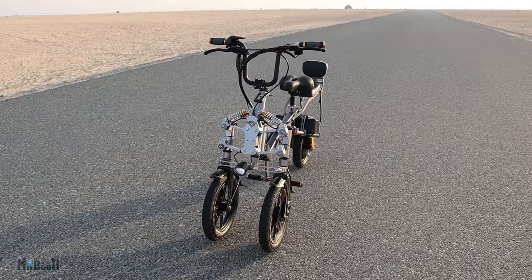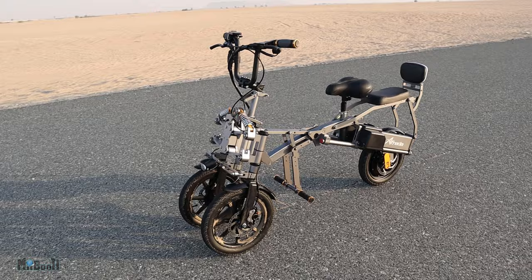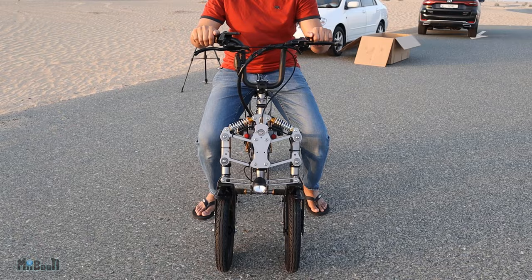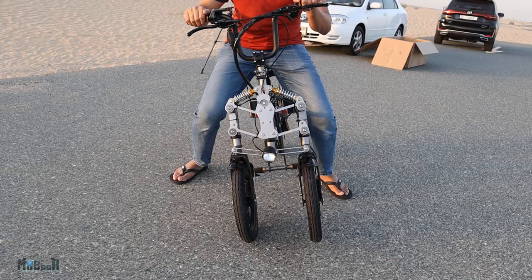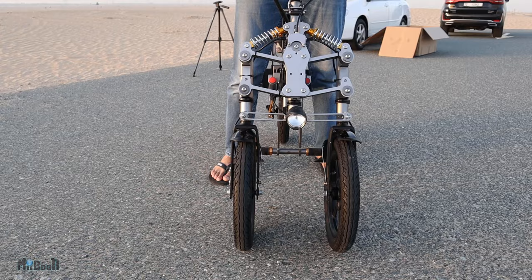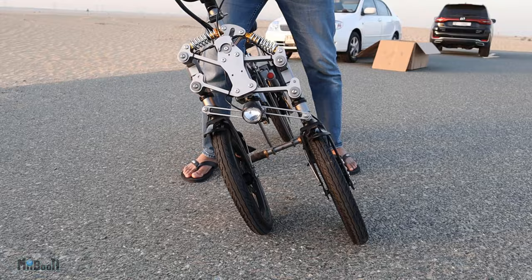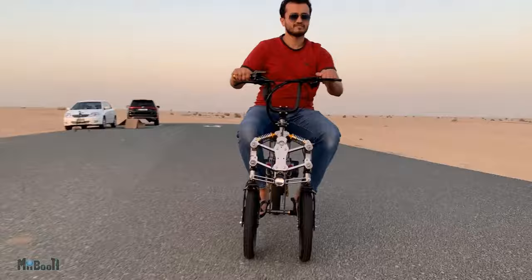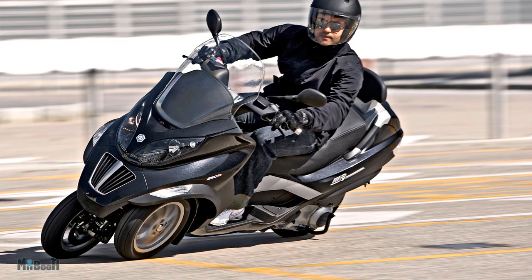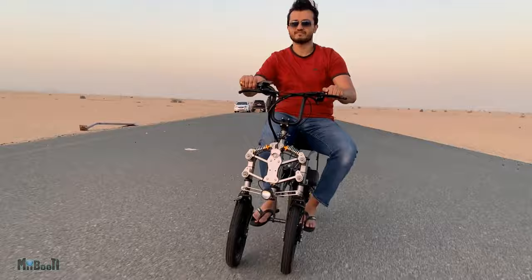You might not have noticed, but the bike does not need a kickstand. Due to its three-wheel design, it stays completely balanced so you can get off and on without dealing with a kickstand. This leads to another feature: the turning mechanism. Since it has two front wheels, when turning a sharp corner at speed the bike naturally leans to one side and lifts one tire. However, if you unlock the mechanism via the lever, the tires lean simultaneously, allowing the bike to lean and turn at speed while providing double grip, so it never loses traction. The bike can lean a total of 50 degrees, a design inspired by the Piaggio MP3 bike from Italy.